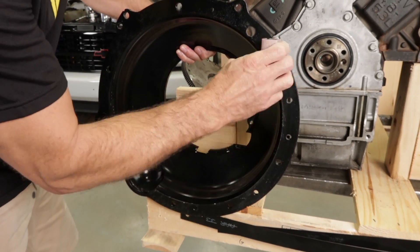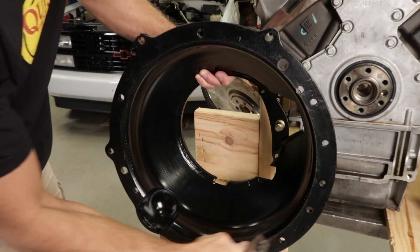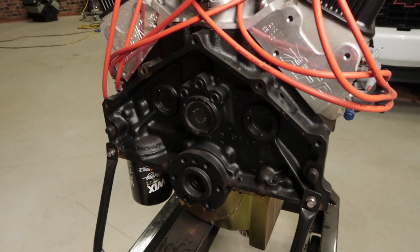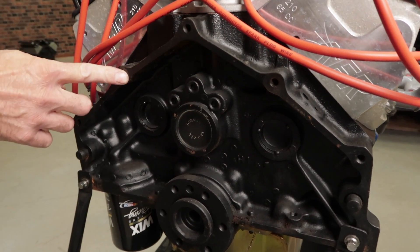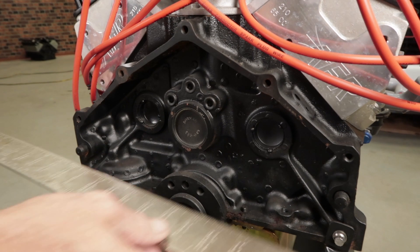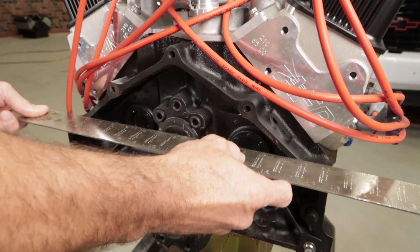Running the block with sandpaper over all the surfaces can actually help pinpoint any imperfections that you missed with the naked eye. Some engines may have threaded plugs and set screws, or even a frost plug that can protrude past the mounting flange and interfere with the installation of your block plate or bell housing. I see this on Mopar engines especially — just run a straight edge over the back of the engine block and check for any issues before you mount anything.